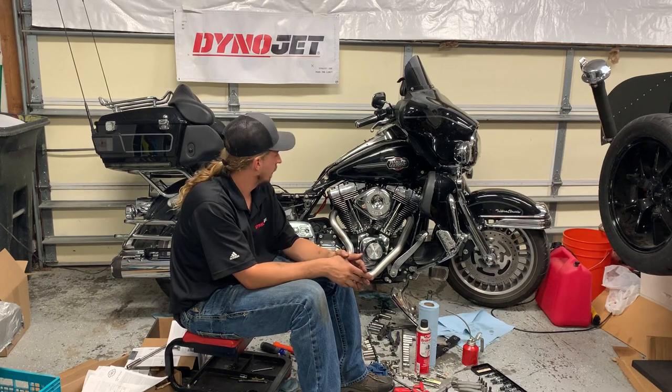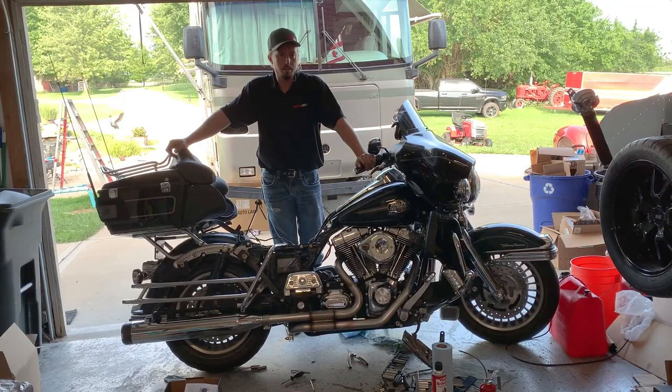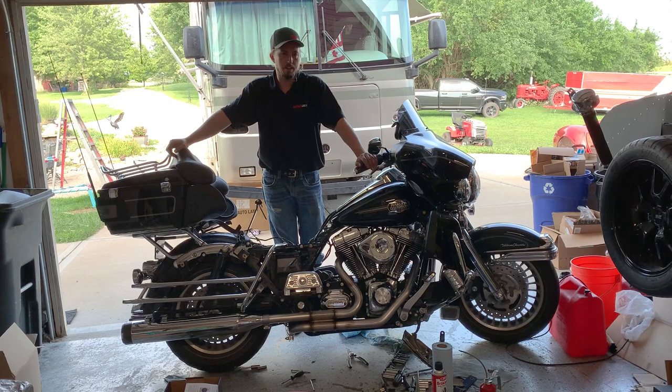So it's been sitting on the charger for a little bit. I'm gonna give it another shot and see if it'll start. If so, we'll see how it sounds, and if not, we'll call it a day, and I'll try again on Monday after I can get a little bit of input from some other folks on what else to check. Well, I said you need to go take a look at everything, make sure that you didn't miss anything, and it's pretty hard for an engine to start if the fuel tank is not connected to the fuel line. So, oops. Let's see if it starts now.